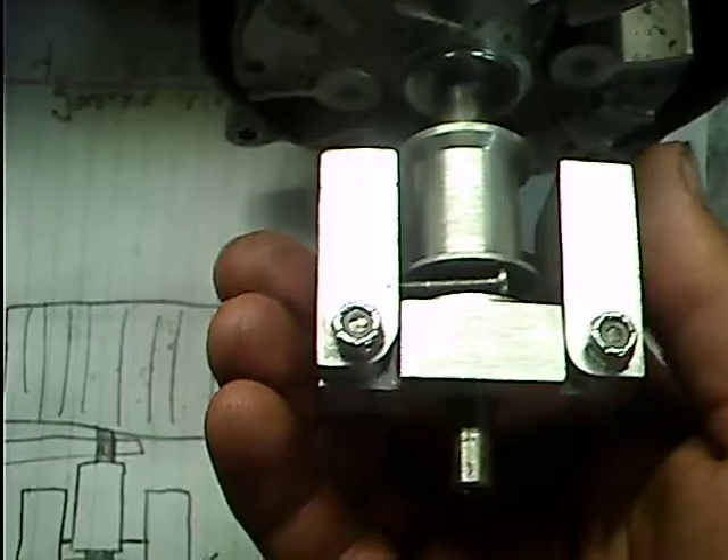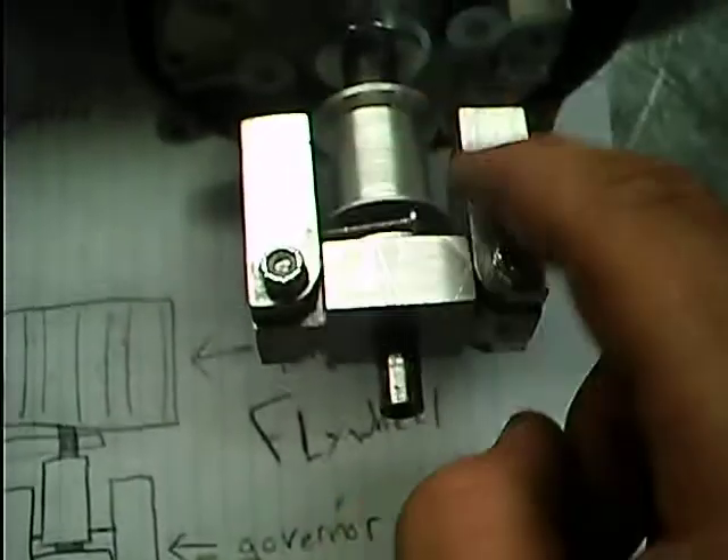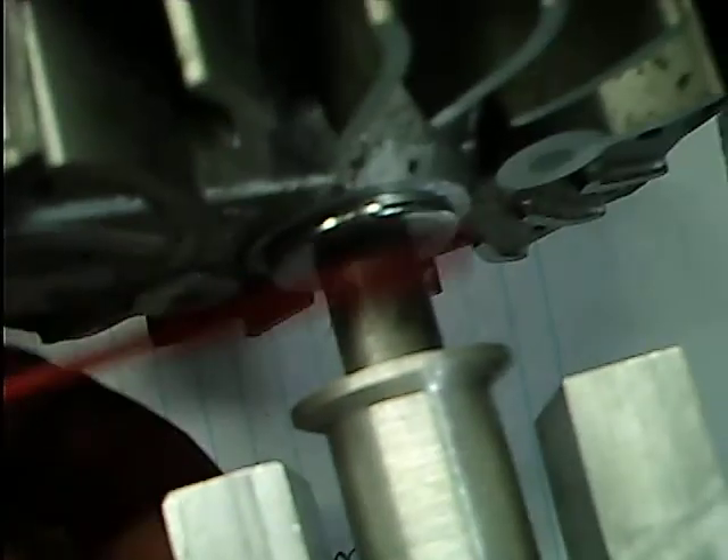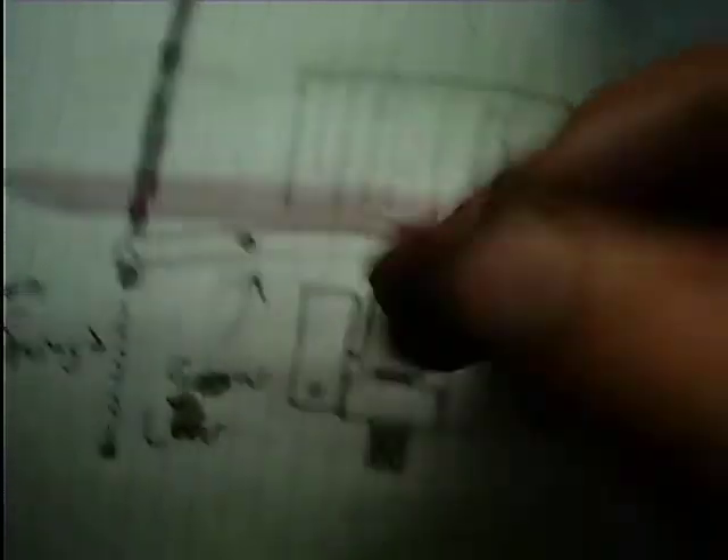This right here is the flywheel on the engine. The governor is a piece of quarter-inch keystock with a hinge or pin so it can turn back and forth on that hinge pin. It will ride in the space on the governor's spool. This rod here is shown in top view — it'll have a return spring to help force the governor down as the engine coasts and slows down. That'll probably just be held with a cotter pin — nothing fancy.